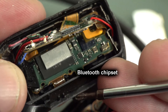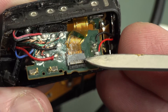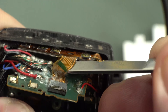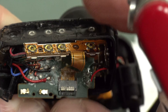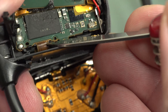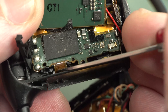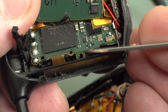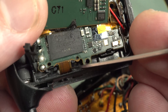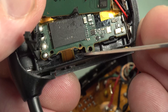I'm actually quite impressed by that fit-to-envelope design. There's not much left over. Double-sided load on that top board. The bottom board - that'd be your memory, and that'd be your applications processor, presumably. Because you've got to have all your memory in there. On the other side, no connector - that is an integrated rigid flex solution. They've manufactured that board as a rigid PCB plus flex in the middle, so you can do away with the connector. Because obviously you haven't got much room left over in here to put your connector.